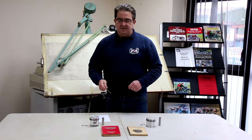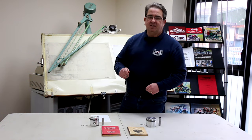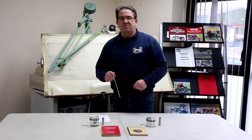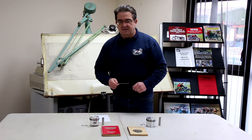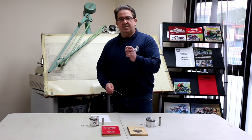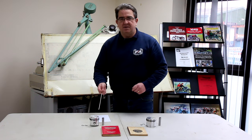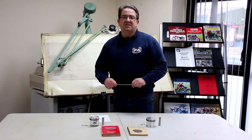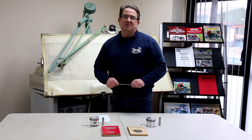If you've got any questions about this, please feel free to ring me — I'd rather you did so we could talk it over, rather than you just buy the pistons, fit them, and they seize. It's something you need to check. Personally I would always go for a sliding fit in a plain aluminium small end, not a push fit. If it's too tight the heat will build up, make the situation worse, and you'll end up with a seizure. Any questions, get in touch with myself and Simon at Andover Norton and we'll certainly help you out. Thank you very much.